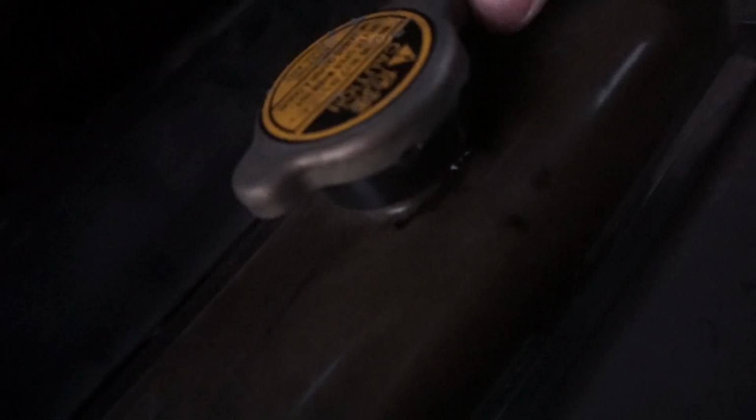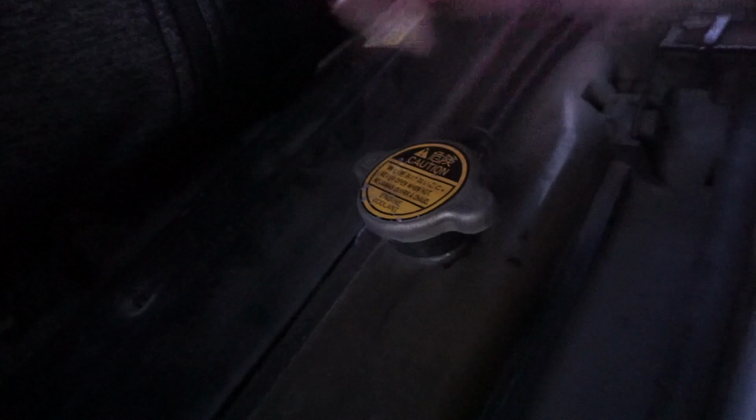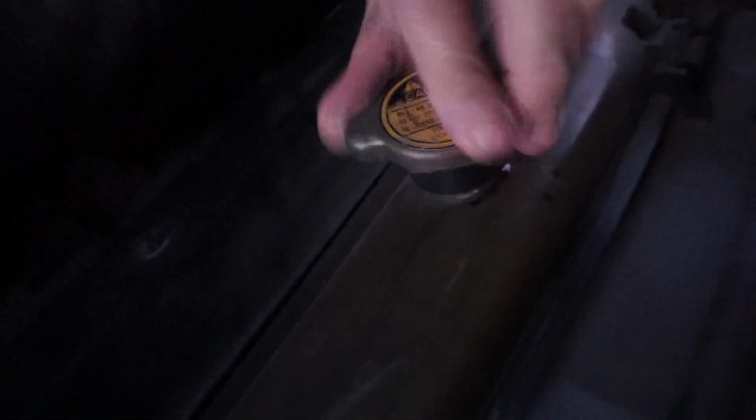So what I noticed, you can kind of see it right there. There's a hairline crack right there. So we're going to go ahead and clean this hairline crack, and that's what we're going to try to repair. It's right on the border. I think when they put the pressure tester right above it, it might have been wiggling or whatever the case was. I'm assuming, again, be careful, I'm not a professional. Make sure the car is cold, or for sure there's no pressure in there.